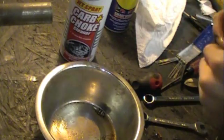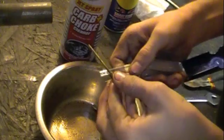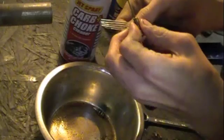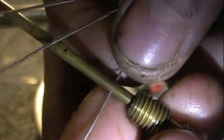What you want to do is take a little bristle from a wire brush or something and run that through there, or take one of those little tip cleaners from your kit for cleaning brazing and welding tips — find the right size. I've got the smallest one here. Run it through and clean it all out, get them all nice and cleaned out. Run it up to the top too. Then spray it down with your carb cleaner.